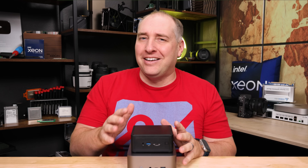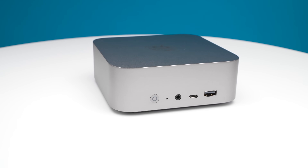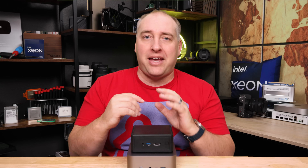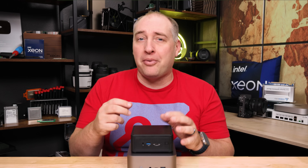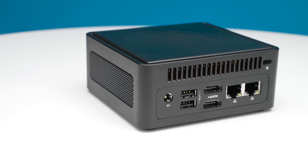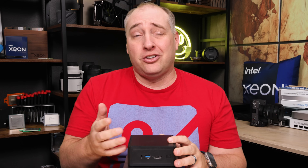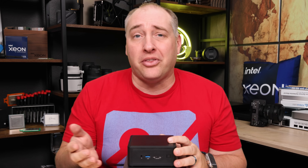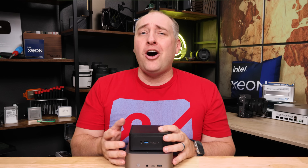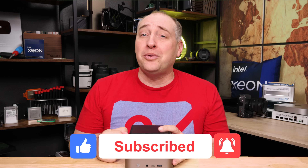Overall, I think I have a pretty good picture of these two systems. If you're going to play games or use it as a desktop, the B-Link SER8 is the better option. But if you want to make a server or process data — like taking video input from cameras, decoding it, running AI operations on it — the more connectivity, smaller size, and lower power of the ASRock Industrial is probably what I'd go for. I hope you liked this look at these two systems. We have tons of other mini PC reviews, so check those out, and if you liked this, share it, give it a like, subscribe, and turn on notifications. Thanks for watching, and have an awesome day.